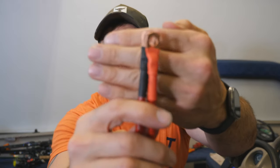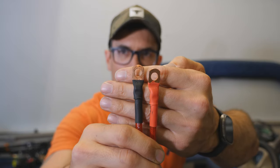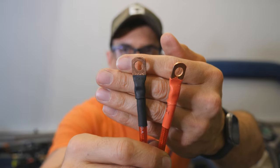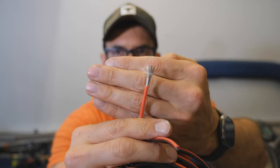I'm going to show you how to wire this, but first a couple of warnings. The crossover cables I have are older cables I made in one of my first tutorial videos — you can see they are copper. You don't ideally want to use raw copper because of corrosion with water, especially salt water. I keep my connections really clean and there's almost no corrosion on these. But if you want to go with the standards, please make sure you use tinned copper — these will be silver in color, not copper color. Same thing for the wiring: use tinned wiring, which is why it's silver. Make sure you're using the right components, and I'll have links in the description for wiring, lugs, and all that good stuff.